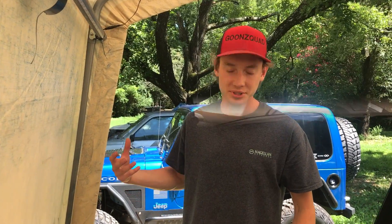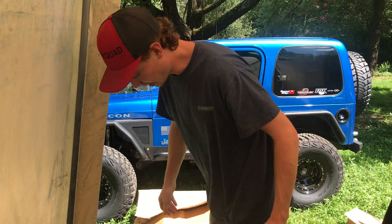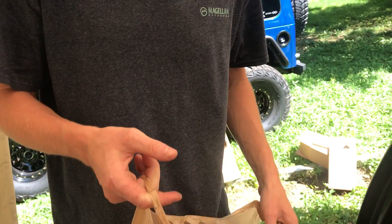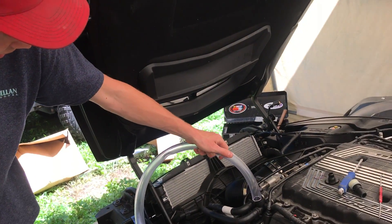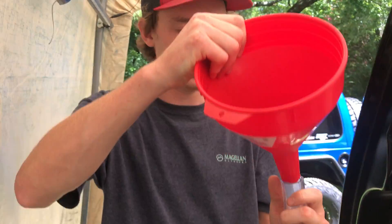We just got back from Ace Hardware with a funnel, a couple of tubes to purge this system, and three gallons of distilled water. We're going to be mixing with the antifreeze 50/50, using distilled water to dilute it. We bought one-inch tubing to go over that port, put a little clamp over it to make it tight, and put the other end on the other side to slowly purge and get as much air out of the system as possible. If you have too much air in the system, your car will lack power and won't run right.